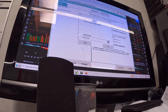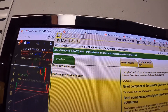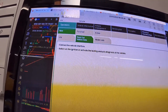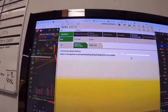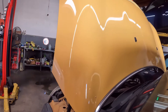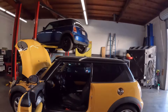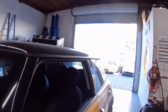It was blood, sweat, and tears going through it, but all in all it worked out. I just reset the adaptation values of the transmission — it says they were reset, I screenshotted it. All the codes are clear. I'm going to back out of it and we'll go for a little drive to see if we've got third, fourth, fifth, and sixth gear. I'll run it up the road and then come back and spray down the engine.